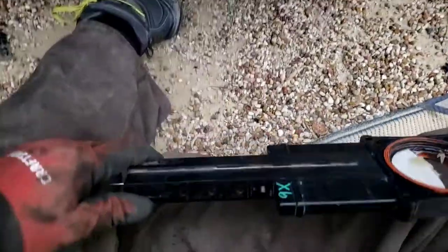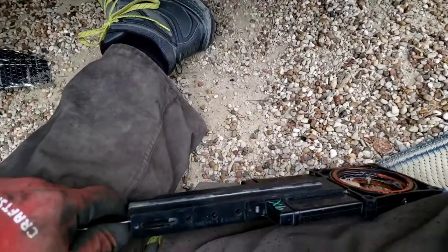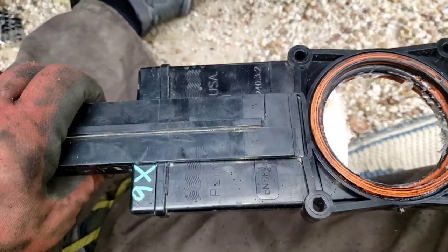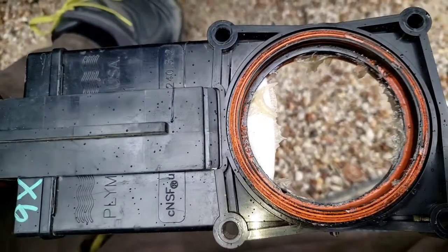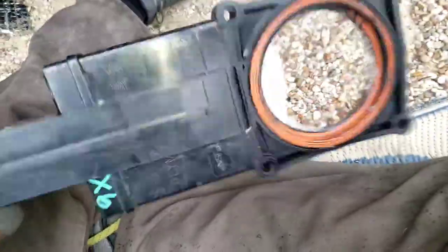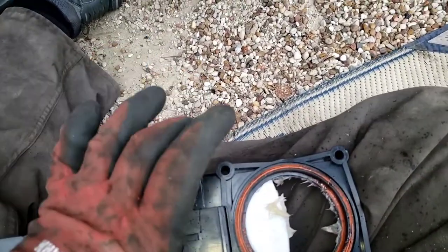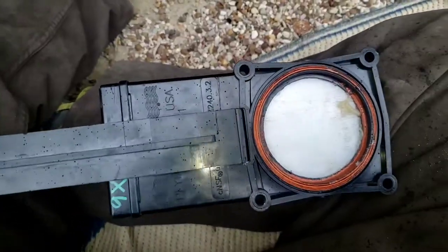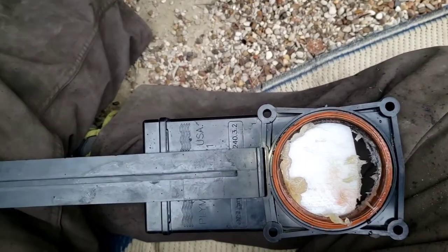A little more explanation of how this valve works. You can see I've got it out now — I've got it marked with tape at the very tip, and that's as far as I want it to go out. The red tape marks that limit. If you get too far there's a little niche in there and it really becomes a bugger to go back in. There is silicone plumber's grease to help it slide in and out. Make sure you don't tighten these things down to a hundred foot-pounds, because the tighter that goes on top of this the harder it presses on that seal and the harder it is for the gate valve to open and close.